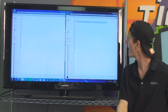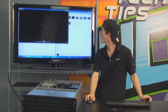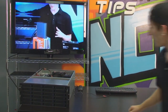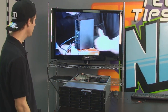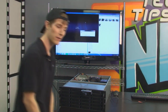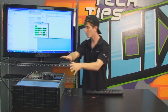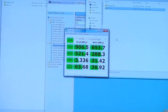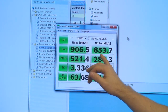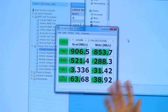Here's something to watch out for. I'm going to do a practical demonstration — we are playing a video from a kiosk about the WD MyBook Live. I'm going to pull one drive, just arbitrarily. And that video is going to stop. Windows Media Player encountered an error. RAID 0 is not safe. I threw my drive back in and the RAID 0 is running again without any problems. I went ahead and ran CrystalDiskMark: in a synthetic benchmark we're getting read speeds over 900 megabytes per second and sequential writes up around 850 megabytes per second.